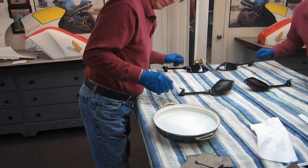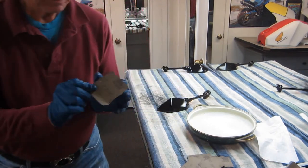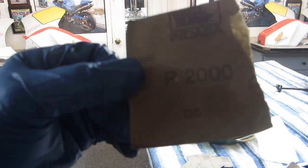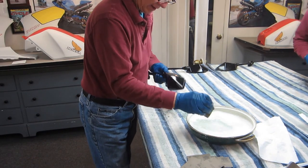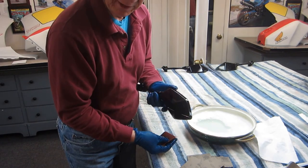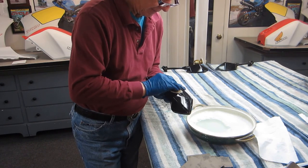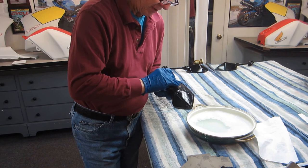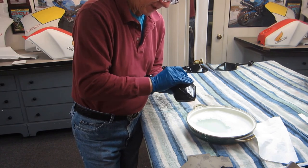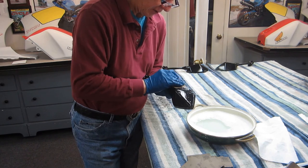I'm waiting for Glenn to get here, so I figured I'd get a little bit of work done on these mirrors. What we're going to use - what Glenn and I are going to use all day - is the 2000 grit Indasa Portuguese sandpaper. I want to do a test to see if the paint is ready. This is really less than 24 hours but it's been up by a heating vent. If the paint is hard, it's easy to figure out - you just do one little test. If the paint's not ready, we'll put it back by the heating vent, but if it's ready I can get this buffed out before Glenn gets here, because I'm trying to leapfrog several projects all at the same time.